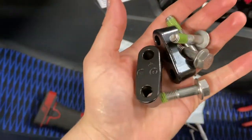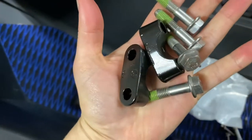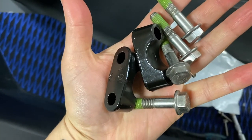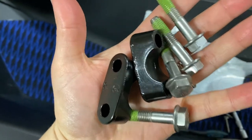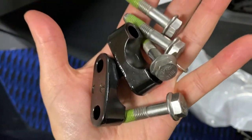You've got your handlebars, your clamps, and your four bolts — we're going to put them up there. Make sure you keep alternating which bolts you're tightening down, because if you tighten one too much, then the other one's too loose. The handlebar bolts are a 13.